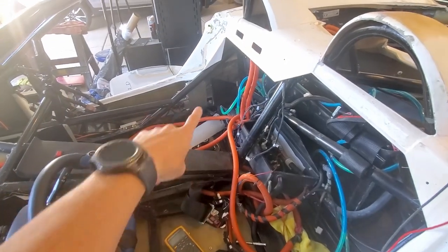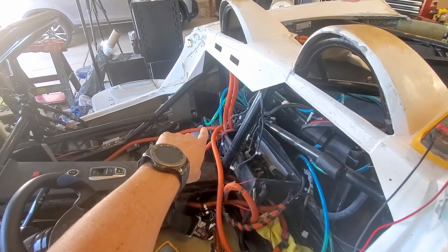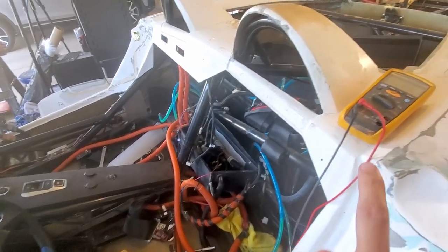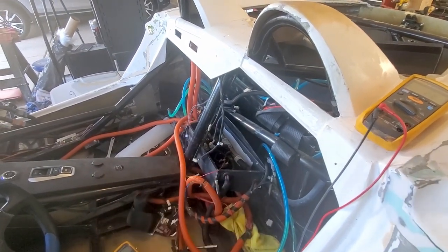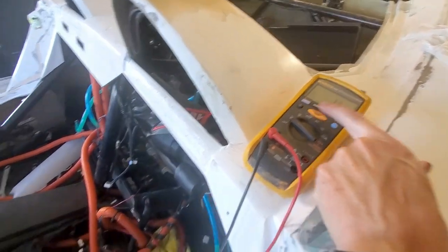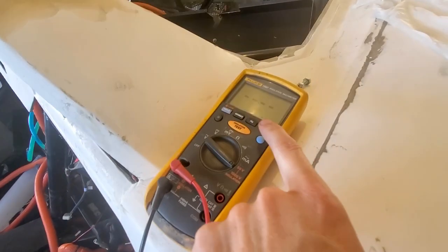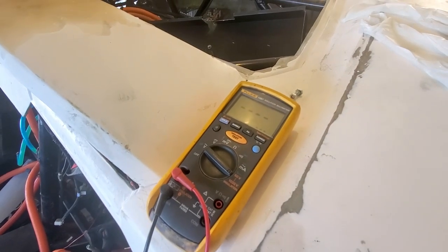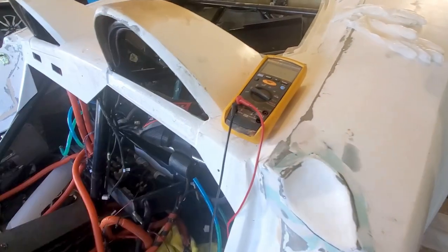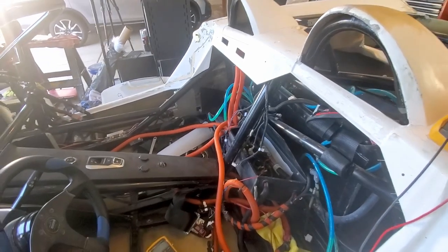I thought I would try an experiment, so I took my cooling plate and leaned it up so it's touching both the frame as well as the battery module cooling elements. What I've learned is that when I go to do the isolation test, it won't even read. It starts crackling, and I think it means I've got a loss of isolation. Can you hear that? Do it one more time. You can hear some pops. Previously it had 2 gigaohms resistance, and now it won't even test because we're so low. So I do believe that's the cause, but can't be so sure.